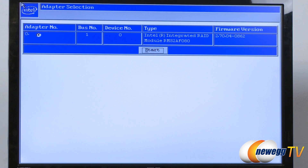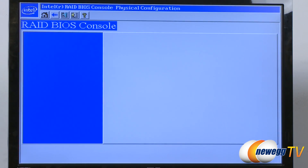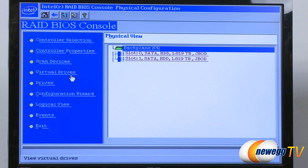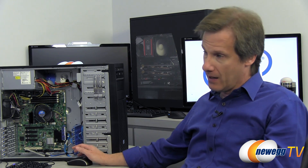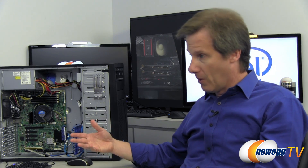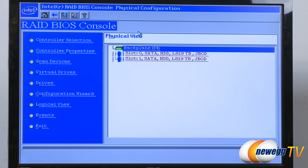After hitting Control-G, we go into the RAID configuration utility. We're going to set up a RAID 1 mirror — mirroring our two 2-terabyte hard drives. We've done the Control-G and we're into the setup screen for the RAID controller. Since we only have one RAID controller, it's easy — it's already selected. We'll hit Start. Mouse support is nice here, and actually this is one of the things that came with EFI — it was created to give you, among other things, mouse support in the BIOS setup screen.